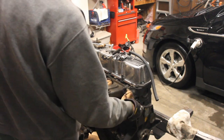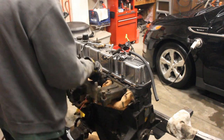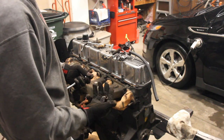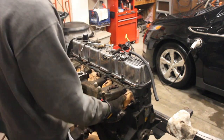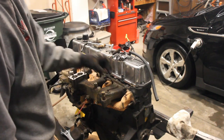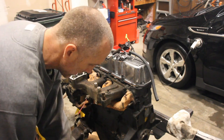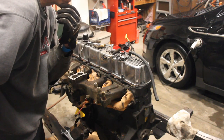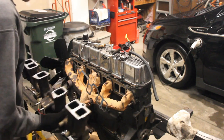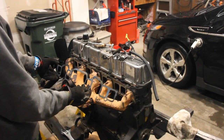I'm not quite sure there were enough washers on here — two regular and a lock washer. I've got a feeling that was probably not the original setup, considering all the other ones have this thick washer sleeve on it. Be very careful about taking out that last bolt, because at that point nothing is holding this in place. And there it went — it just spilled antifreeze all over my foot. Well, there's truly nothing better than not being able to heed your own warnings.